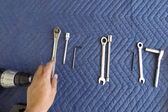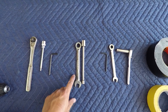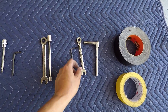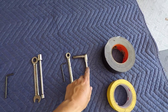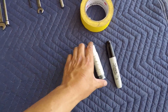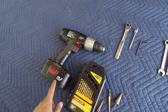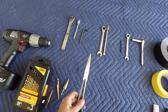Here are the tools you need to do the job: some Allen keys — 5mm here — and a 13mm ratchet wrench and socket for the risers to the trunk. 4mm and 10mm for the risers to the wing. 10mm socket for the trunk lights. Duct tape, masking tape, marker, touch-up paint. Drill bits — a step bit would be ideal. A drill. Pliers are optional and a cutting tool is optional.